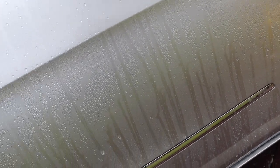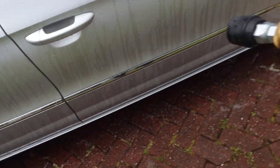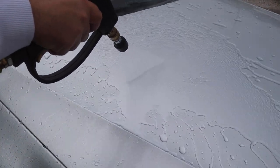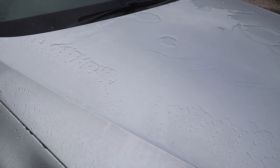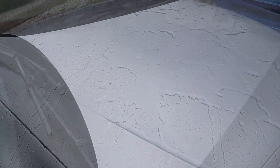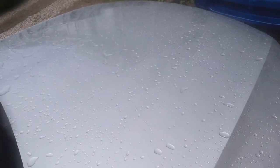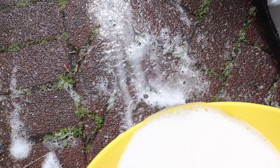But let's go and take a look at what the bonnet was looking like — remember how flat that was looking before? Here's a little reminder: a clip from earlier showing that initial water behaviour on the bonnet. It was still sheeting off but a fair bit slower across the centre of the bonnet, with water gathering before deciding to move off the panel. Now after the wash, it's back to performing the way it should be — no pooling of water, moving off the panel super quick, beading up nicely. That's what you want to see from a ceramic coating after a car's been washed.